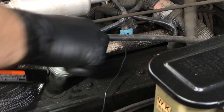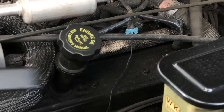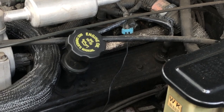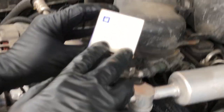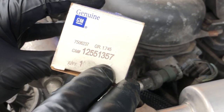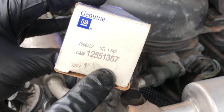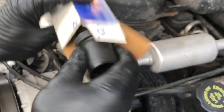So if it's moving on you, that's what the problem is. No leak here, but I do have one of these on another truck that's got a problem, so I'll be able to share a part number with you in case you need one. The part number on this is 12551357, and this is the part number for the oil filler tube that screws into the valve cover on the driver's side on these Vortec engines.